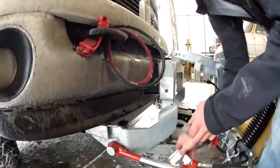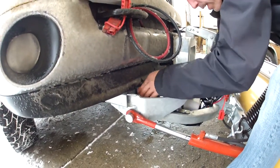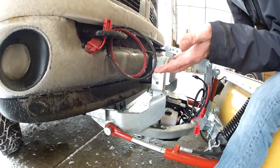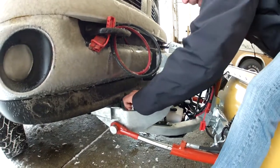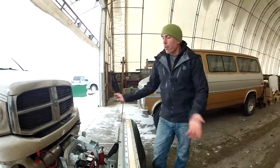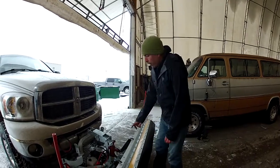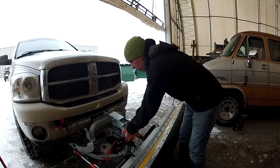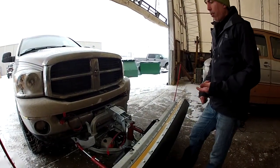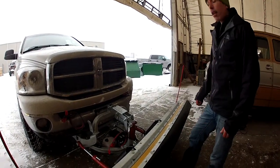If it seems tight going on the bottom of the crossbar, two things: either push your front frame or lift it — that rotates it up against the bottom crossbar, allowing more space underneath to drop that clip on. If it doesn't even want to line up and you're having trouble sliding it onto the crossbar, the cylinder probably isn't fully collapsed — it has air in it. Just push it down all the way. It's very important when taking the plow off the vehicle to collapse that cylinder before you unplug everything.